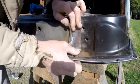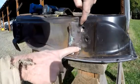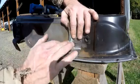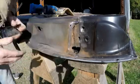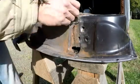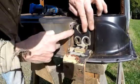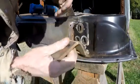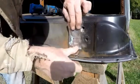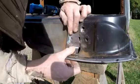Now once you get it to where some part is right, like say if we get this line correct, we can weld this line and then start hammering it in as we're welding it and get it all spotted. The only thing that's going to be really important is it has to be flat as far over as the hinge goes. So over to right here, we have to keep it flat. It can't start curling out. So that's why we want to get it fitted like that.